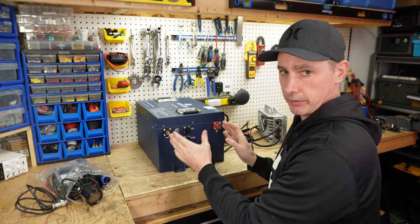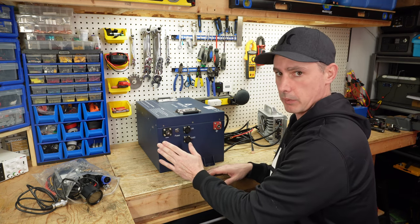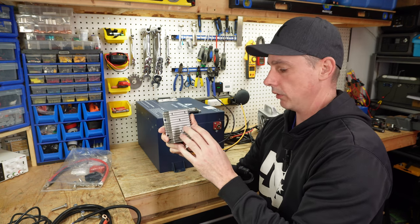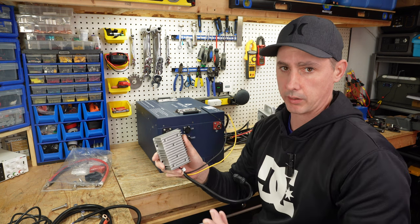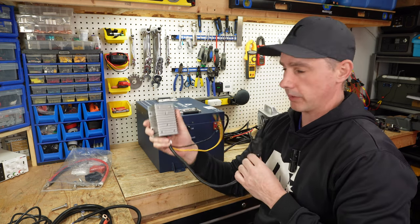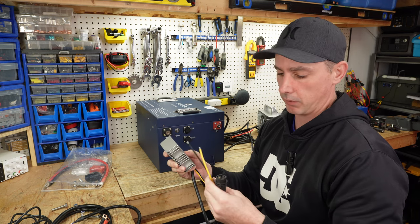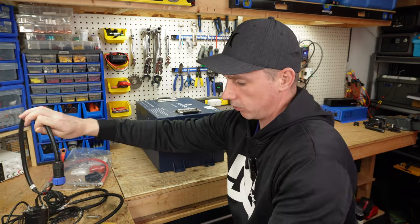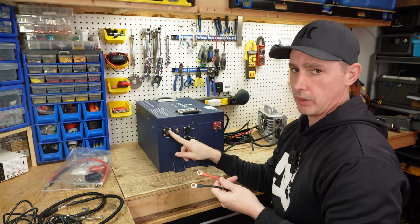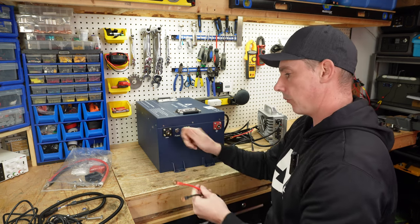You would connect your positive and negative for your cart up to that as well. I would suggest putting the cart positive and negative first, then putting the charger positive and negative over top of that. What also comes in the packet is a buck converter — this is going to take voltage from 48 or 51.2 volts nominal and bring it down to 12 volts. So if you have any accessories, like a radio, USB plug-ins, or a cigarette socket for a cooler on your golf cart, this will allow you to do that. Or if you have turn signals or anything that runs on 12 volts, this takes it down from 48 volts to 12 volts. They give you another plug-in for the buck converter as well. I would put the cart cables on first, then the charger cable, then the buck converter cable last, then bolt and tighten everything together.